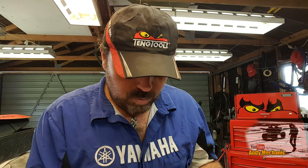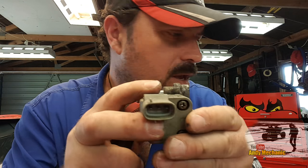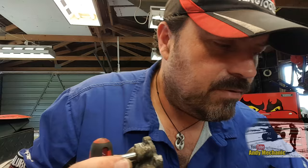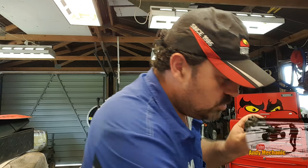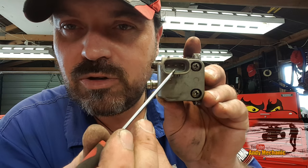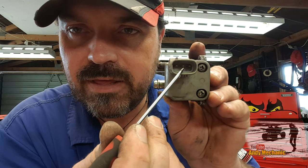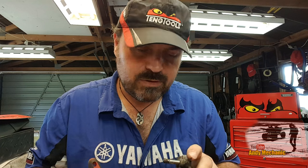Okay, well, things are looking up for the little round four at the moment. I found a few more components today that actually do still work, which is great news. Now, those terminals here. Okay, I've got a little diagram, so I want to make sure I get this right for you. First of all, small screwdriver. Sorry, right. Very disorganized. The middle terminal here, that's battery positive, 12 volts going in there, and it's these two outer terminals here that the ECU grounds.